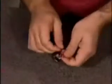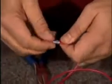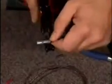After the signal wires are installed, you can loop power to the 30 and 85 terminals on each relay. Combine 2 red wires into a female spade, and then cut one side short, attach another connector, and plug them into the terminals. Do that for all 4 relays, and then add extension wires to run the accessories to the car.